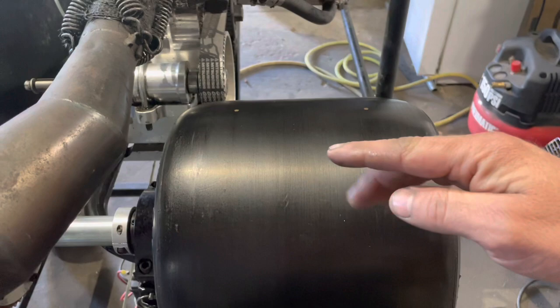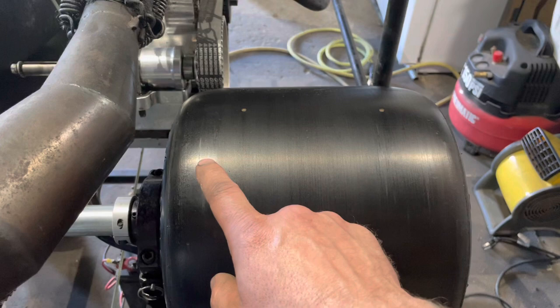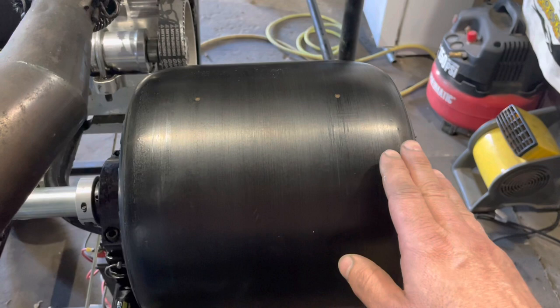As you would want to slide this way, this tire is gripping this way. So it is actually ballooning the inside edge up. When people talk about losing the edge, your tire pressure is going to affect this. The lower tire pressure you have, it's going to cause it to exacerbate — it's going to make it worse.